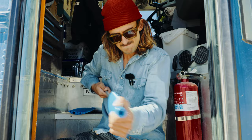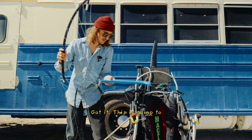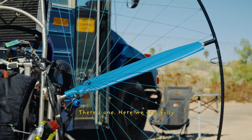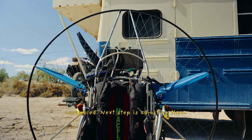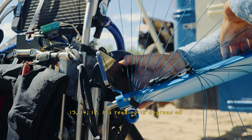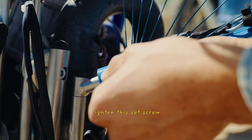Apparently I need to set them to 15 degrees on the paramotor. The motor wants to turn right, so it needs to be sitting to the right. The fin clips right on there and snaps together — here we are fully assembled. Next step is adjusting them. With the paramotor level, I use this flat point to adjust to 15 degrees. It's reading 15 degrees off this flat point, so I tighten the set screw and it's locked in place.